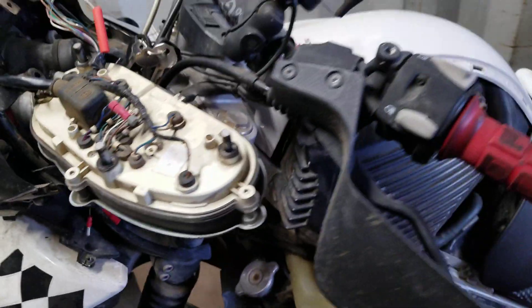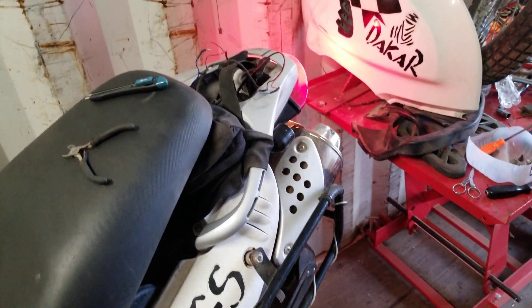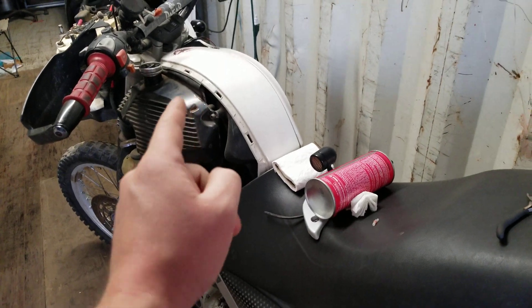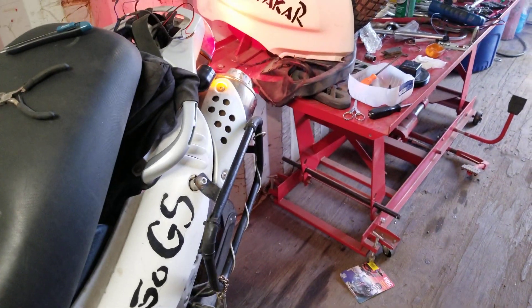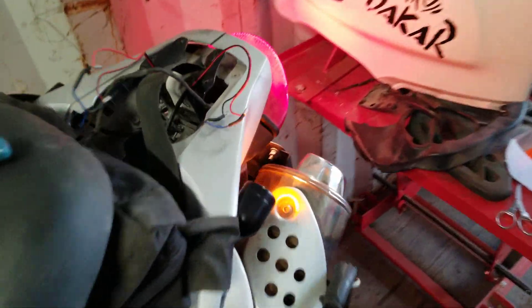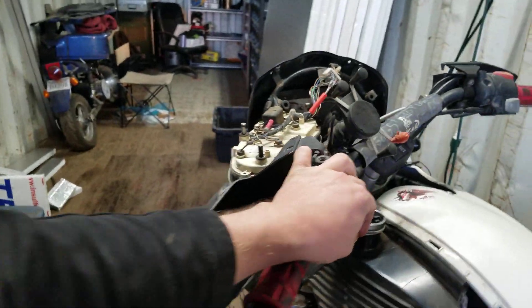The other side of the bulb goes to ground. So the other thing you have to do — once you've done this, or maybe you've done it already — you have to buy what's called a solid state flasher relay. I haven't set mine up quite properly yet because it doesn't appear to be blinking, but now we have left and right correct as we flip the wires.